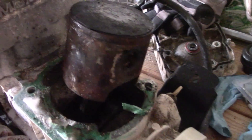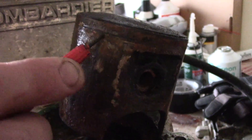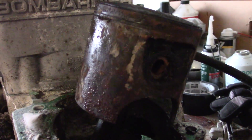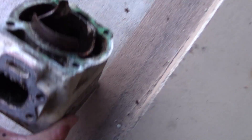After about an hour of pounding - you can see the sun's already almost down - there's one piston right here. I don't even know where the hell the ring is. Well, that ain't even a ring anymore. You remember when I showed you they had 10w30 in a two-stroke? I'm guessing maybe they ran that thing until she seized. That was one head - although it busted right there. Now after one head I got it off, and I'm curious if this other one's going to come off. I saw a jug on eBay for 25 bucks.